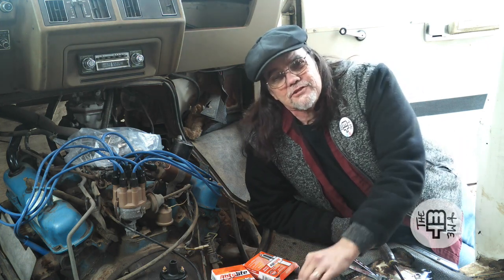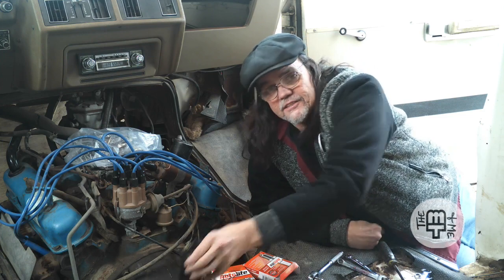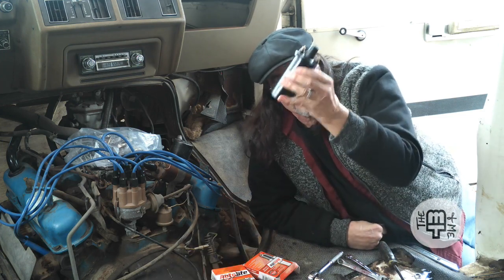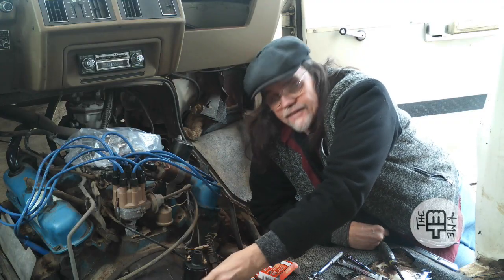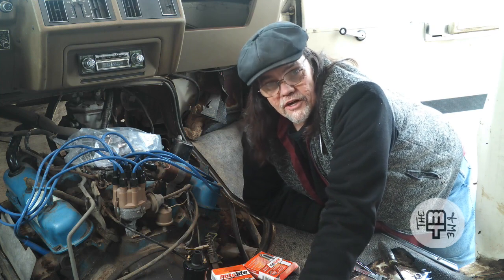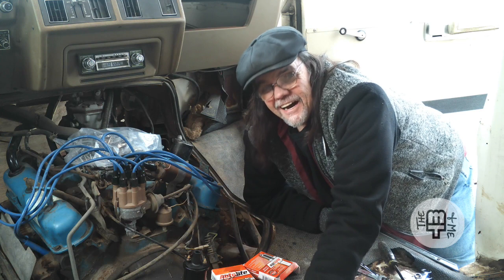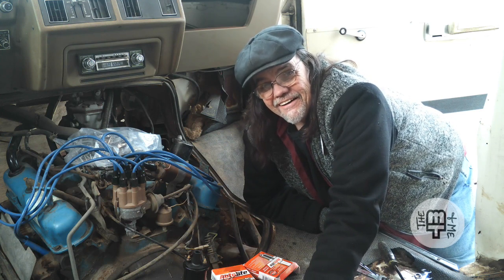You may also remember that I told you I had ordered spark plugs and they were running a little late and they'd probably get here about the time I finished the video. Well, sure enough, two days later we get our Autolite 65s — brand new spark plugs, exact replacement for what is already in Pearl's 360 engine. As an added bonus, I also got a brand new ignition coil. We're gonna swap this one for the old one — it should be an exact replacement as well. Plus we're gonna get under the hood and do a little measuring for a new battery and see what we need to do to build a tray to hold it, because I think the one there has some problems.